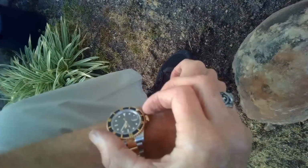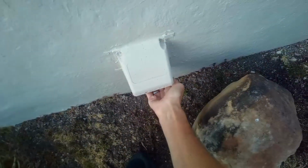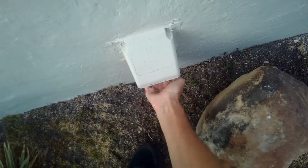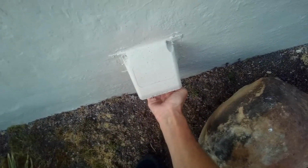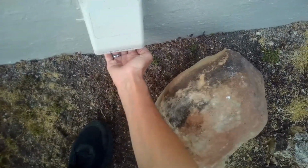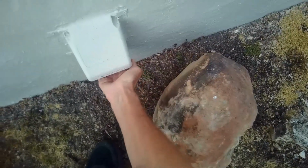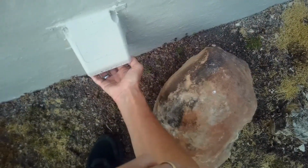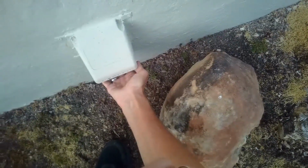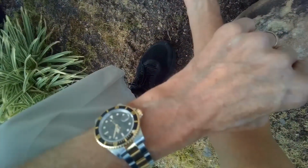Once the dryer warms up though, these flame duration times will probably get shorter. But when the dryer is stone cold and you first start it, you should get in a healthy dryer 3 to 3.5 minutes. If you don't, the gas coils may need replacing, or you may need to clean out your dryer vent tube, because if the vent tube is clogged, the dryer will cut its heat prematurely. And that'll also cause your clothes to not dry very well.